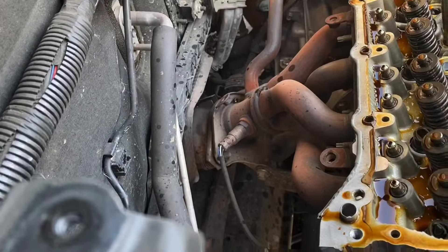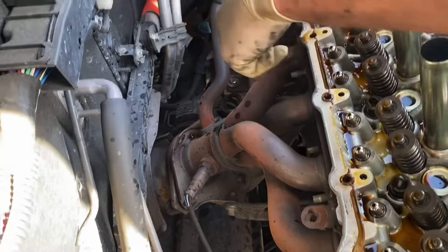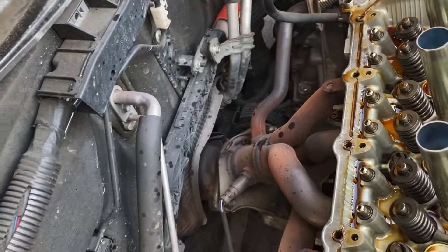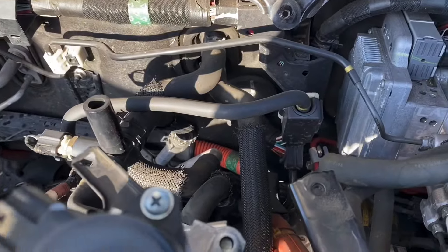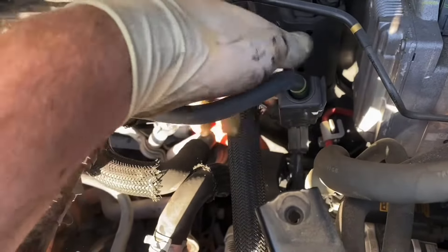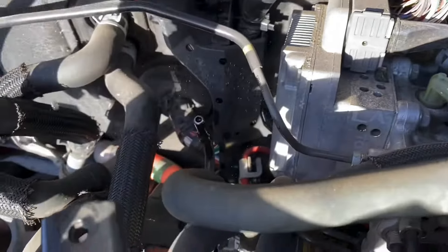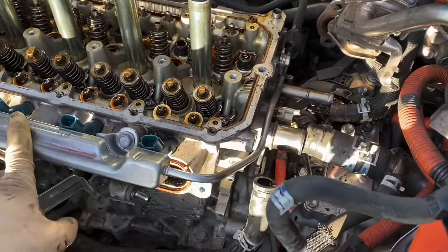With the cam train off, we can get to the exhaust. There are five nuts on the studs — there, middle, there, and on the back side you can't see beyond that pipe. There's about a 14 for the bracket — that's all you need to take off for that. I'm going to use a two-inch extension and a deep 12 millimeter. As he's removing the exhaust nuts and the 14 millimeter exhaust bracket, let's talk about the fuel line. You have a little tip right there — just pull this out, pull the white apart, just slides right off. You have the yellow tabs on both sides, give those a squeeze and drape it over. There's no need to remove the fuel injectors or the fuel rail — leave it attached.